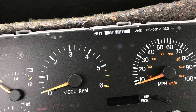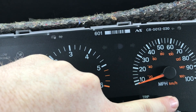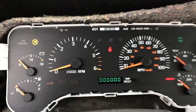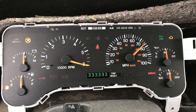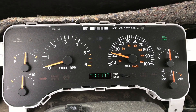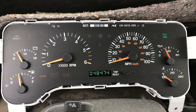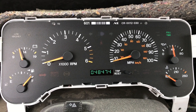If you notice, this one is a little nicer and newer — the needles aren't so faded and it's a little cleaner. I'm going to do the self-check on startup: hold down trip reset, key to on. Now going through the self-check, all my needles move. The full sweep of the needles is apparent and everything lights up, so this is a good cluster and we're going to replace the other one rather than try to repair it.